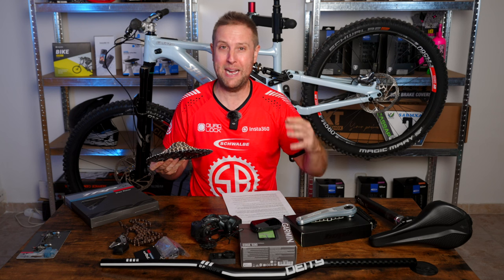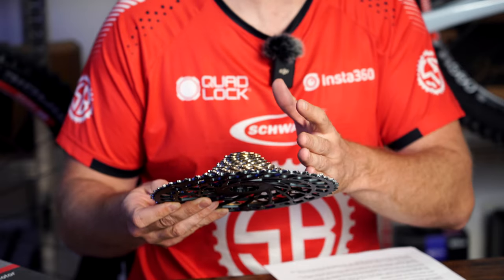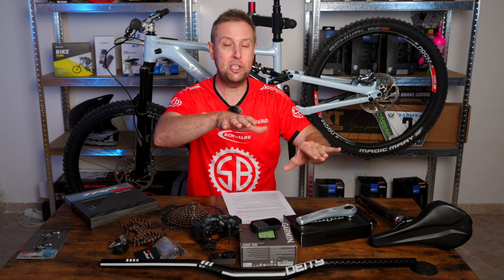I think GX is fine. I've heard on forums that the more expensive derailleurs and chains aren't as strong as cheaper ones, but I don't think that's true — I've never broken a chain or ruined a cassette. It's more about how you change. We have a lot of torque going through these motors, so when you're changing gears under load while climbing, think of your leg power as a clutch. Take that power off, do a clean change, make sure it's changed, and then gradually put power down for maybe a quarter of a pedal. You'll be fine.